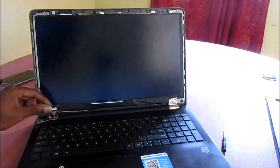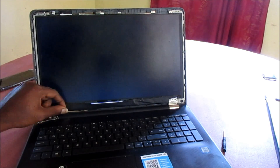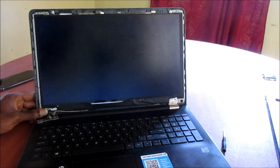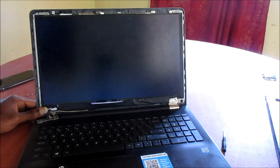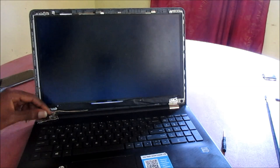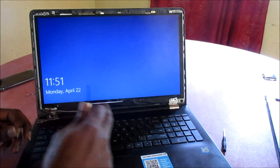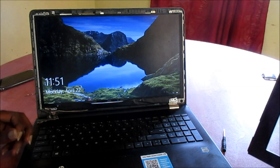Before you panic, you will want to ensure that your data cable is in properly behind the back of your screen. Most of the time it is a data cable issue. I recommend that you check your data cable at the back of the screen, especially if your laptop hinge is broken — you will experience some sort of data problem with your device. I hope that this video was helpful. I am going to go ahead now and screw back up the bezel for this laptop.